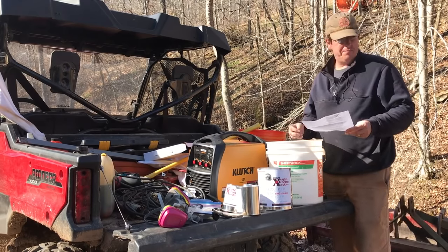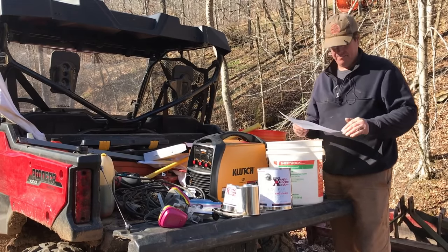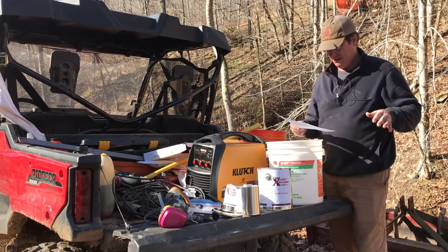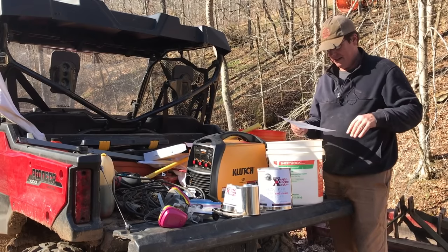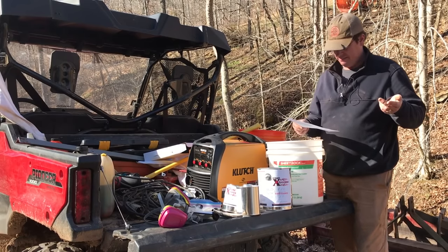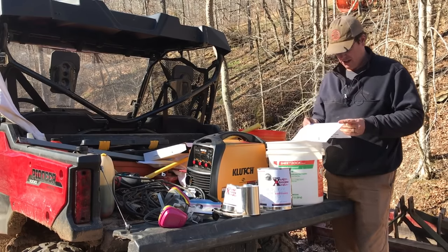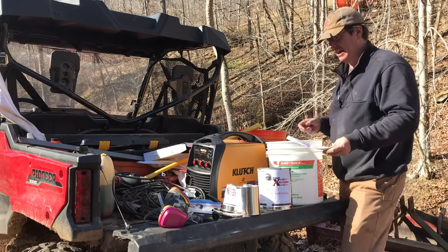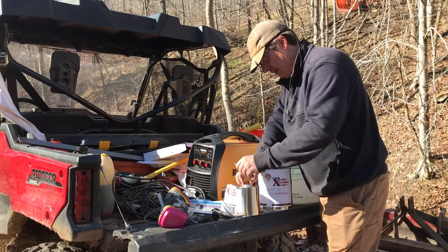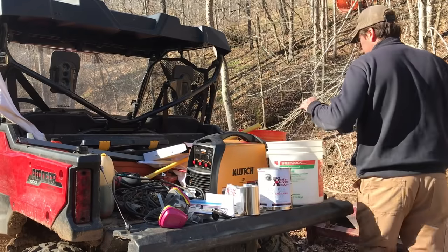If you're looking at preparation, again, there are a lot of instructions on the website about prep. The instructions come with it, but if it's a painted surface, maybe scuff it just a little bit and you're good to shoot. If it's bare steel or fiberglass, they recommend a primer; for chrome, an etching primer; for plastic, a plastic-based primer. So it just depends on what you're shooting. But typically, if you're going to use this for a bed liner or something like that, you're going to have an already painted surface there. So you're just going to scuff it up with some sanding paper or a wire wheel, or something to that degree.